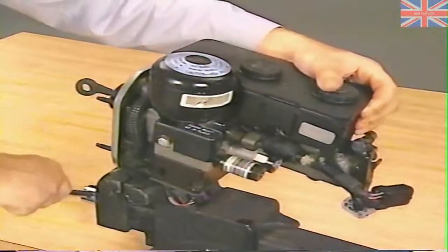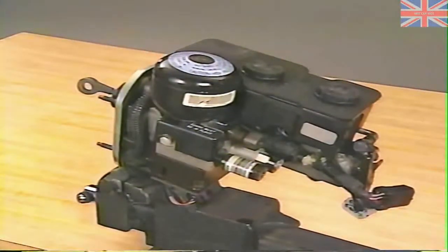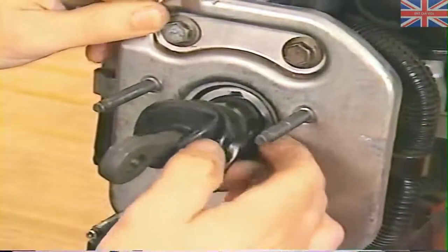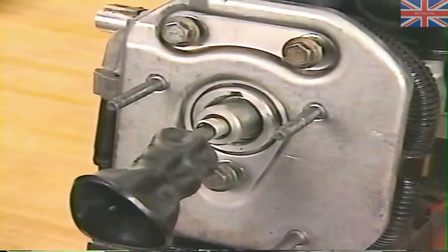Next, secure the hydraulic assembly in a vise. Be careful not to clamp any of the electrical connectors. Remove the mounting gasket from the hydraulic assembly mounting bracket or from the dash panel. Now the black dust boot should be separated from the master cylinder housing. It may be necessary to temporarily loosen the mounting bracket.